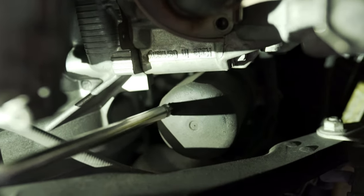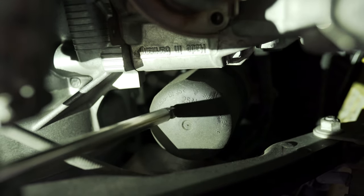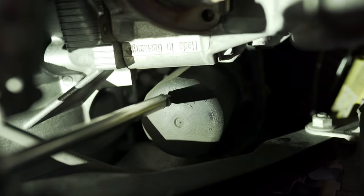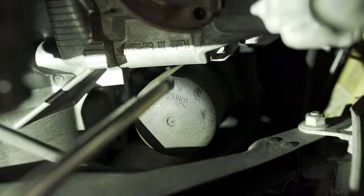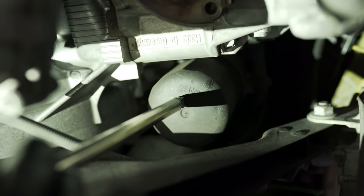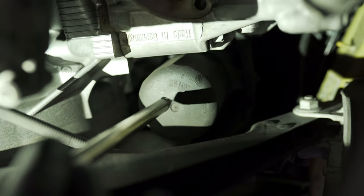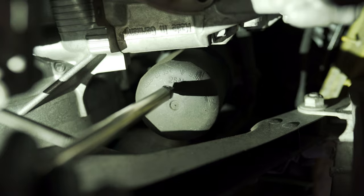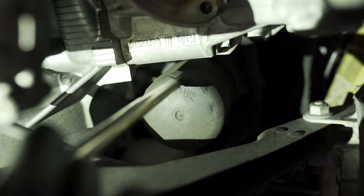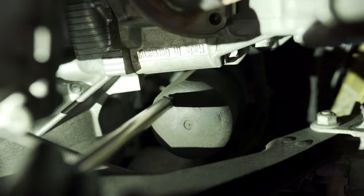The oil filter is located on the driver's side — this is a left-side steering wheel car. So the oil filter is on the driver's side, pretty much right next to the header. You first install the tool I showed you, then an extension or maybe another one, and just take it off. I probably won't be able to show you how to do that on camera, but you'll figure it out — it's not that big of a deal, but it's going to be messy.